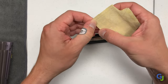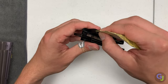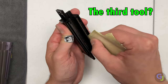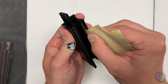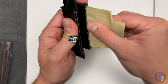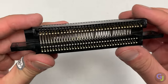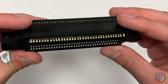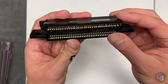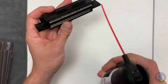You can do this with a small tool or screwdriver and scrape each pin to get them nice and bright again, but I like to use some sandpaper instead. Just lightly buff the pins to get the surface corrosion off and they should look nice and bright when you're done. Clean them off with a little canned air or some IPA to make sure all of the dust is removed, and then you can reassemble.